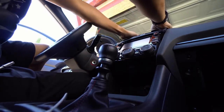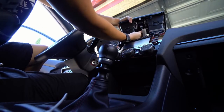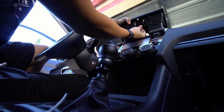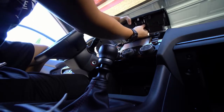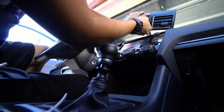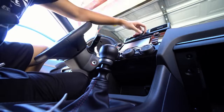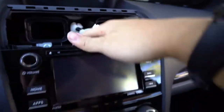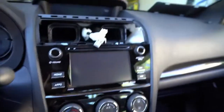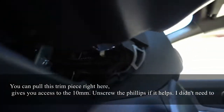I'm going to need two hands. Make sure you disconnect the wires so you get that extra clearance. Now with these ones, they're actually kind of hard to remove, so I recommend removing the top one first — it just clips in. And then this one is still kind of hard to hit, so I like to pop this little thing out and then remove the clip from here. Just a little pro tip. You have two more bolts right here — four bolts in total for this head unit. Kind of a pain, but you just pull this clip and it will expose a 10 mil. You can't miss it.